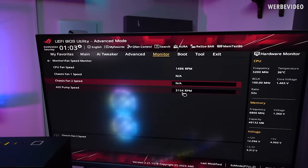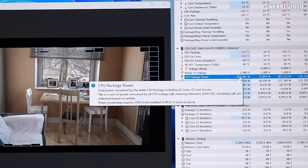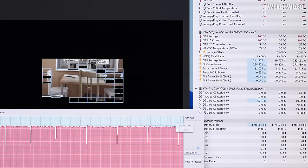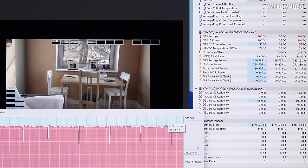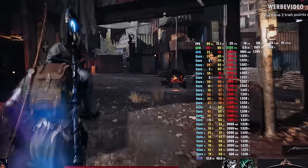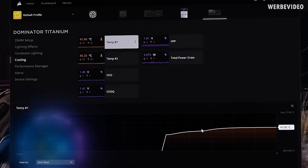The Thermaltake fans are surprisingly quiet. With 40 decibels I can hit about 1,500 RPM. First, Cinebench: as expected the temperature shoots up to about 100 degrees Celsius, but we see a package power draw similar — maybe slightly lower — than what we saw with the Corsair H150i. Again after about six minutes of load, we can see about 240 watts that this AIO is capable of dissipating at 40 decibels, which is perfectly in line with the H150i — not really a difference, maybe a few watts. This AIO runs a few hundred RPM higher than the Corsair AIO at the same noise level but they perform pretty much the same. In Remnant the result also looks very much the same as with the H150i. Now that temperature has stabilized, we see a DRAM temperature of about 47 degrees Celsius on one DIMM and 45 degrees Celsius on the other — an improvement of about 8 to 9 degrees Celsius.